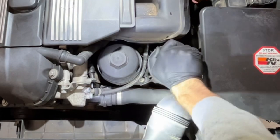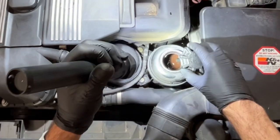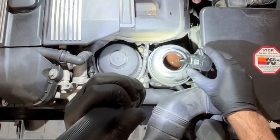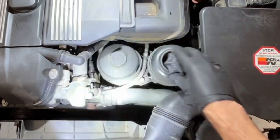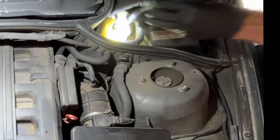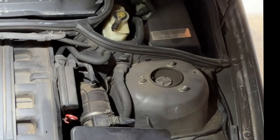Take a look at the power steering fluid. It's up to level. It's metallic brown, a little poopy colored, but that's okay for now. Plus brake fluid. Brake fluid's a little low too, but the brakes are low on life, so those pistons are sitting further out than factory. So that accounts for that.